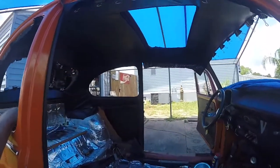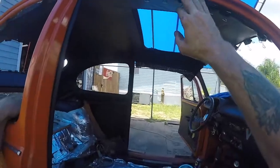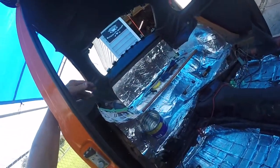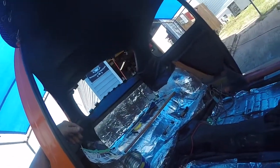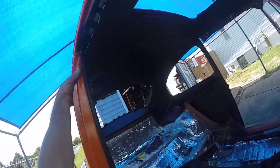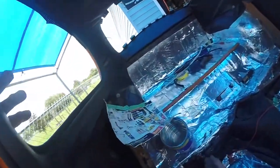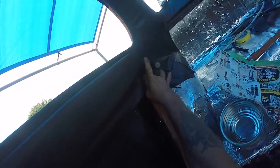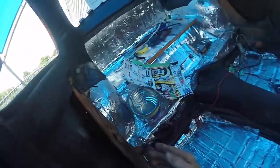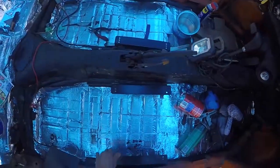All right guys, I've got the seal all the way around the sunroof. There are a few wrinkles but this is my last chance to get those out. A couple wrinkles in the corners — a lot of that will tighten up with sun. When the window seal wraps in there it's going to pull it back a little tighter. You've got your seat belts going here, which might tighten up the pillar, and the panels will go in there and tighten it some. This corner is always a pain — I take a screw with a nice-sized washer, paint it black, and screw it up there where the door panel will hide it. The folds look nice.